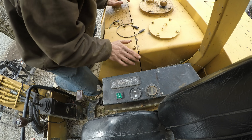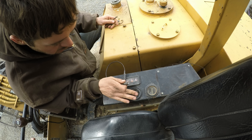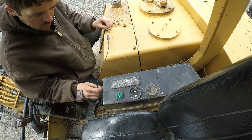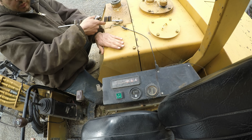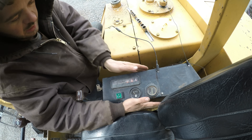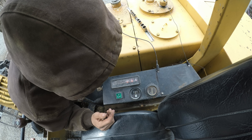The fuel gauge fix is pretty simple. Here's the sending unit which tells the gauge how much fuel is in it. With it unhooked, it goes down to zero, and with it grounded out it should go all the way to full. This whole piece of metal here doesn't seem to be grounded. When I ground it to one of these screws, the gauge starts to move. This entire panel didn't have ground and it definitely should, being metal and part of the frame. That may have been causing both of my issues.